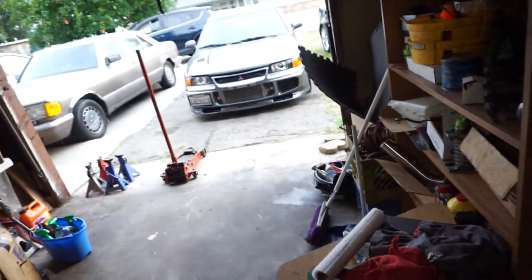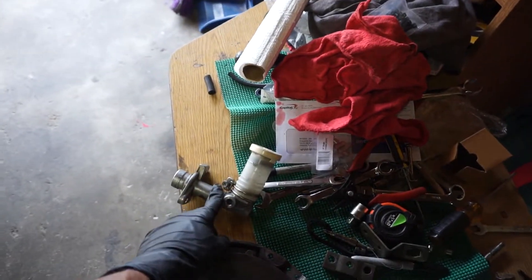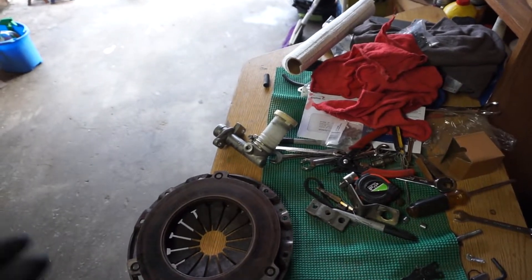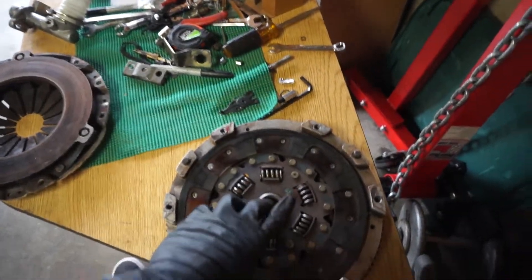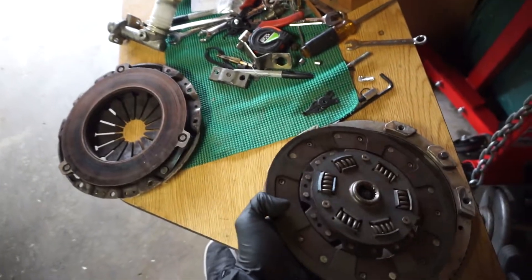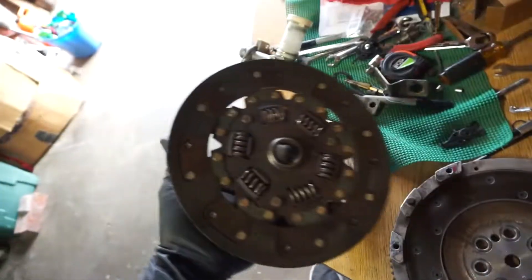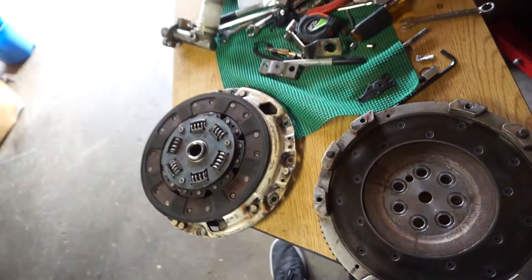What I'll do now is I have 400 miles on the new car break-in period, so I'm going to drive another 100 with the stock one just so I can complete the break-in properly. Since I'm going to change the trans fluid and all the fluids before the car gets tuned, I'm going to take everything apart, go to Clutch Masters out in Fontana, and have them simulate the clutch being heated up to operating temperature and engage and disengage it. I want to see if it's the pressure plate, or the material, or the green coating on the new clutch. I don't think it's the flywheel anymore because I took everything off of it.